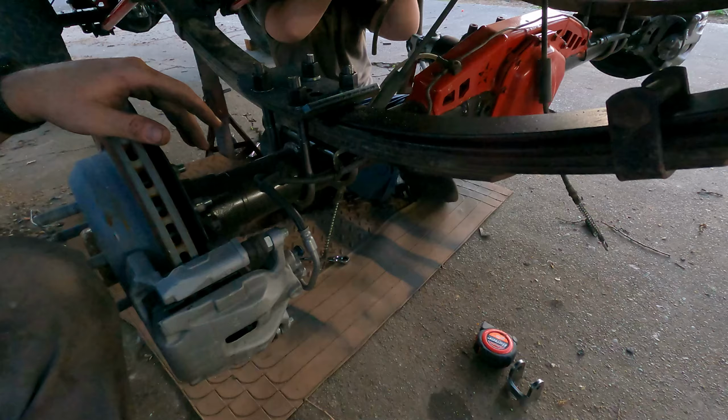Next thing I want to do is I got to install these shock pin eliminators. You can get them at Rough Stuff. And they go in the place where your upper shock little pin goes, because it's only being held by a couple quarter inch or probably 5/16 bolts. And I had so many times those pins fail. So what I normally started doing now is I put this up and then I run a weld bead around it to keep it secure so it never will fall off.